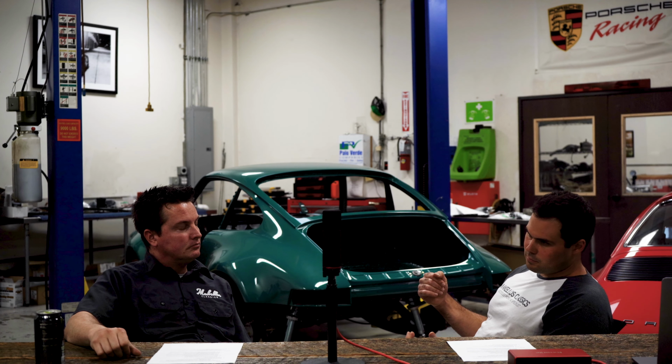In order to fit them in 15s, if you get custom wheels, you can fit them. But the big reds, if you wanted to do that, because that was one of our thoughts, you needed to go at least 16 inches, 17 inches. Depending on how you're having your wheels made. But if you're sticking with 15s, which we would like to go with, it's not going to be too necessary with how light this car is going to be also. Right. It's a matter of matching your braking power to your engine. And the boxer brakes are fantastic. They'll be plenty grippy.